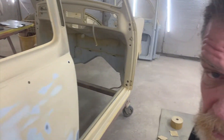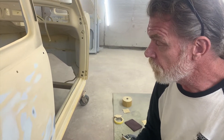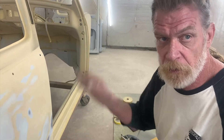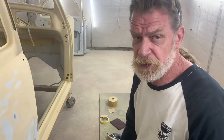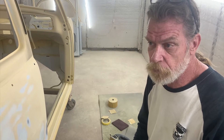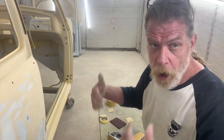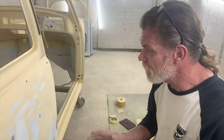So after this, I'm going to do three layers of sealer, let it dry overnight, and start the process of cutting down again. That gives me that last stage right before paint. When we go to paint, we'll do a little bit of spot priming, color and clear until it's good. So that's one, two — three sessions of primer, but probably eight coats total sprayed of primer throughout the entire process. Most of that doesn't stay on the car because I'm trying to take off as much material as I possibly can without having more waves show up.